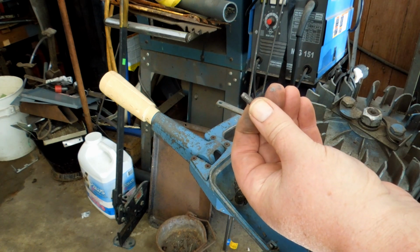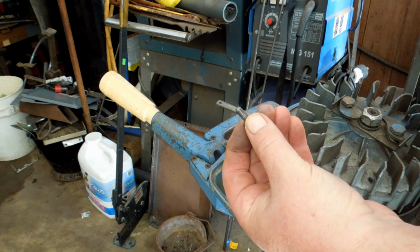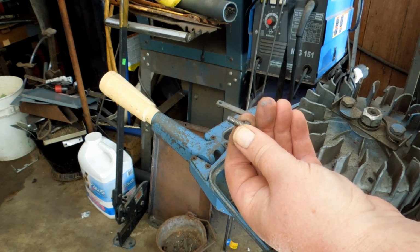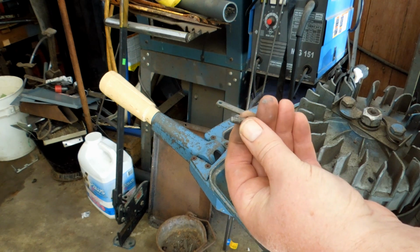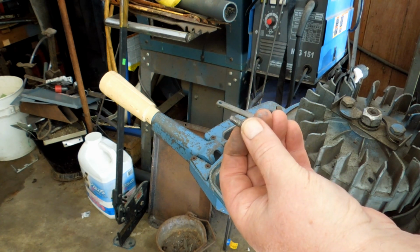Ran into that making armored doors for Humvees. They had every fastener coated with zinc, and it had to be hot dip zinc. It couldn't be zinc plated. It had to be hot dip zinc, and that meant that it was very thick. So we ended up with a whole lot of bolts and screws that were just unusable. They were made originally to the high dimension, and then when they were plated, they were too big to fit.